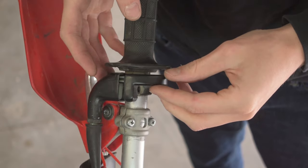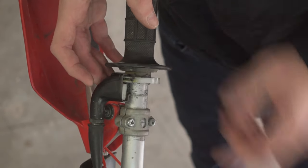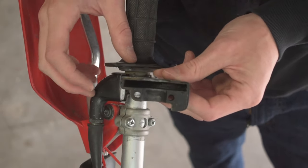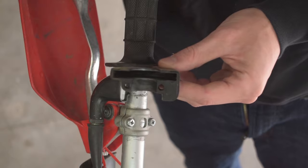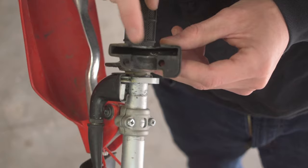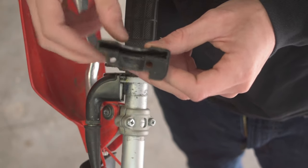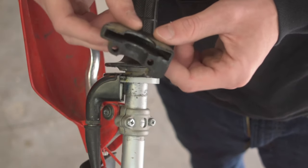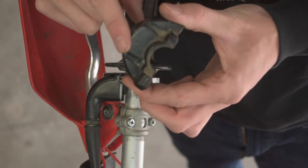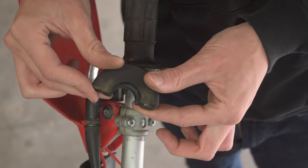Now that we've got those two screws out, we can pull off the cap that was held in by the screws. This white section here is what slides on the inside of the piece you just took off. As we start pulling these parts off, the first thing you want to do is clean out each part. Go inside here and clean it out thoroughly — make sure there's no debris, because debris inside this piece can cause your throttle to stick. Then hit it with some light grease, such as never-seize or some light lubricating grease, to keep this from being rusted or corroded.